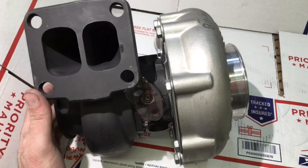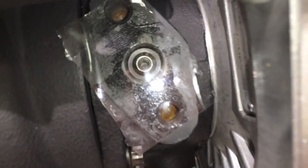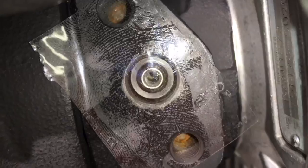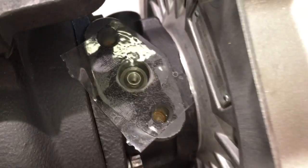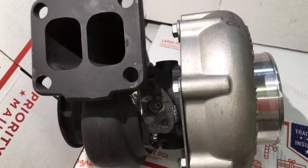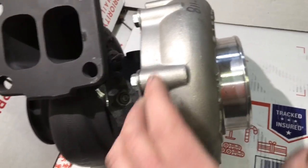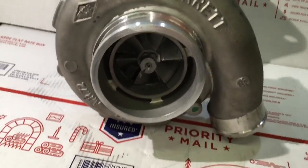There you can see the restrictor pin that retains the cage. The other thing I don't like about this turbo is that it requires a two-bolt flange to bolt on your oil feed. I just don't like the idea of having a gasket at the oil feed — that could potentially leak, and if it's leaking then the turbo might not be getting enough oil to the bearing cage, which could destroy the whole turbo.